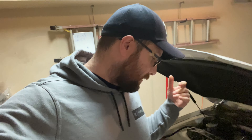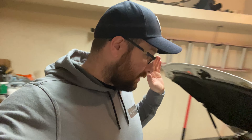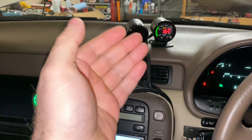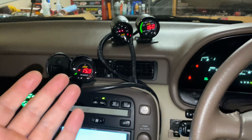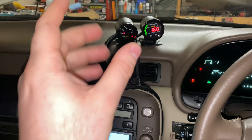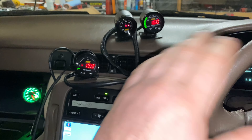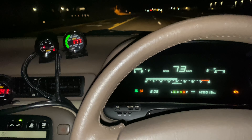It's about two days later and I'm going to test the car — fingers crossed everything works. Those three lines on the display mean the sensor is not working. At this point I think it's an AEM gauge issue that's shorting out the sensor, because I replaced all the sensors and it died almost instantly. Tomorrow I'm going to call AEM; if that doesn't work I'll replace the gauge. In the meantime, let's just drive this thing — let's see what the butt dyno says.